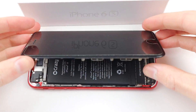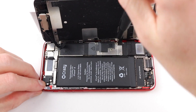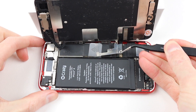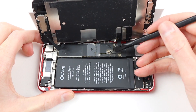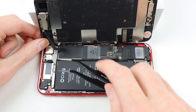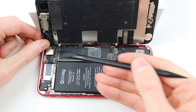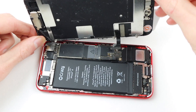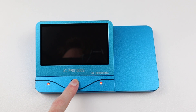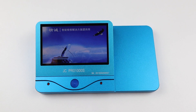I have already removed the screws and loosened up the screen as one of the screws actually wouldn't come out and I had a little bit of trouble removing it. Nevertheless I can now remove the cover plate for the battery connector and screen, as well as the cover for the front facing camera. Disconnecting all of those flex cables I can remove the LCD screen.